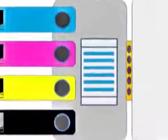Let's take a closer look at how the printhead works. At the base of the printhead, each ink drop is powered by a superheated vapor explosion, typically between 300 and 400 degrees Celsius, each occurring at 1 to 2 millionths of a second. The ink drop is rapidly expelled out of each chamber nozzle at a firing velocity of up to 20 meters per second. Depending on the printer model, between 4,000 and 15,000 ink nozzles are used to fire ink drops down to the paper surface, shooting up to 500,000 ink drops per second during a typical printing job.